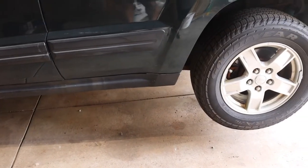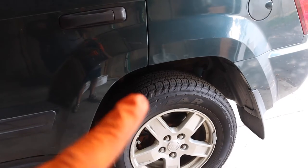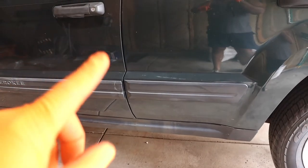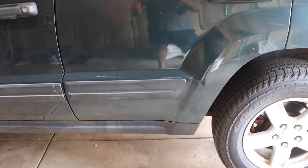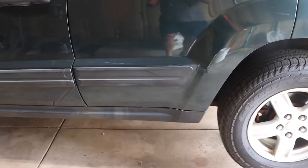You're going to have your fuel filler neck connector that goes into your tank, your EVAP canister line also goes to your tank, you're going to have your electrical connection, and then you're going to have your fuel lines in the back. You should run your vehicle with the fuel pump off. Run all the gas out. I didn't. A little bit of gas is going to spray. Whoop diddly, I'm going to be fine.